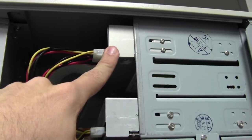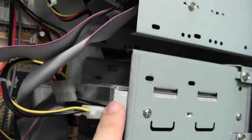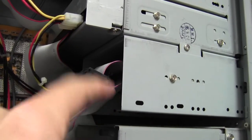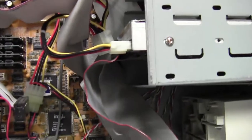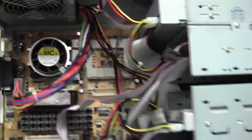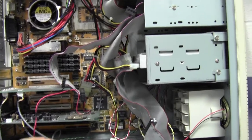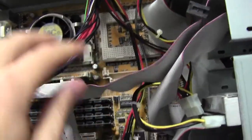When I built this computer, I had an old case and I put in a brand new DVD drive. I had a CD drive from a different computer, used the same floppy drive that was already in there, and put in a brand new hard drive. You'll notice the hard drive is not taking up all the space — you could actually put three hard drives in there, another optical drive, or another small drive. I bought the main board and screwed it in. The main board will not fit inside every single case, so you have to make sure the case and main board match. There are letter codes that tell you which case fits which main board.